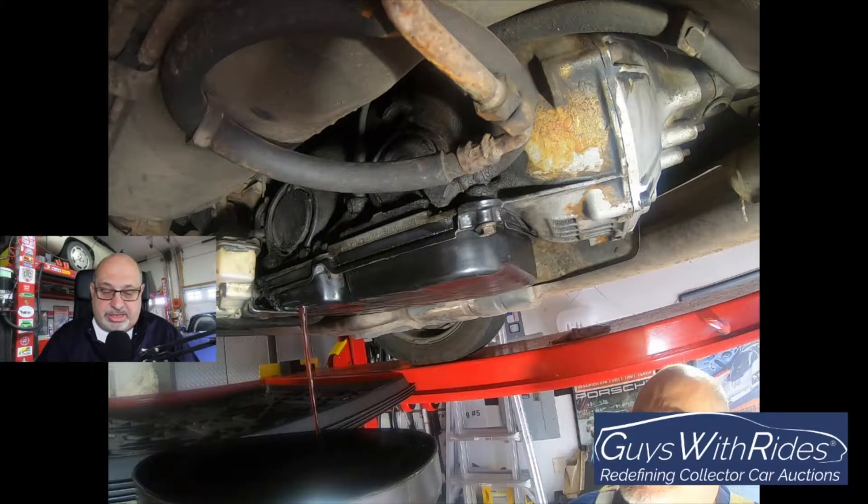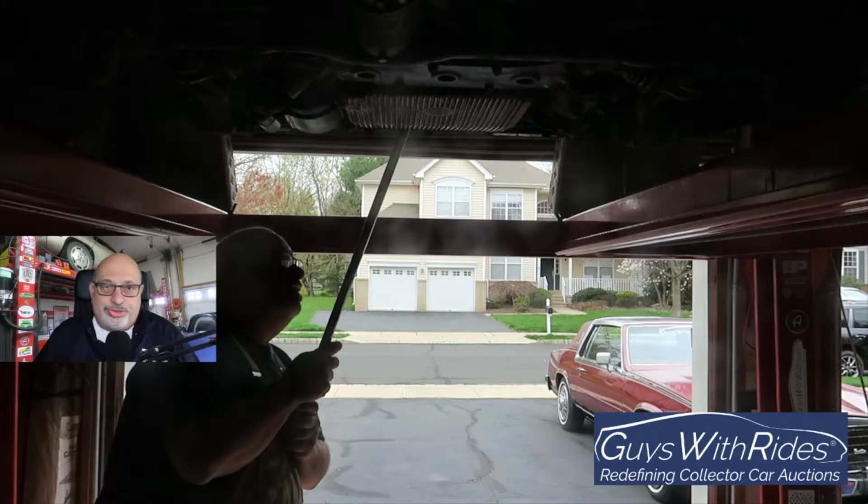You can see at the bottom of the torque converter there are air gaps cast into the housing, so there is also a drain plug on the torque converter. In order to get the drain plug in the correct position, I have to rotate the engine. The 928's 32-valve is an interference motor, so I always have to make sure I'm turning the engine clockwise. The beauty of having a huge breaker bar is that I can turn the engine without removing the spark plugs.